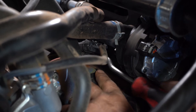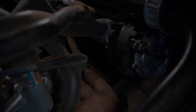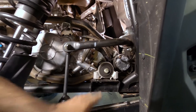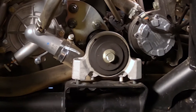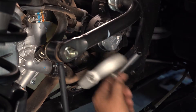We're going to remove our magneto electrical from the motor mount tube and just push it out of the way — that gives us access for our wrench. Now that we have the engine strapped and supported from the exhaust manifold, you can see how we got a little bit of a lift out of the engine tube. It's the same on the driver's side.